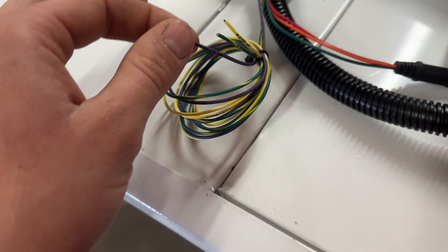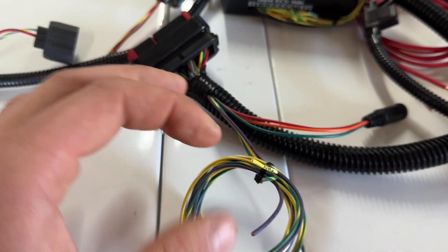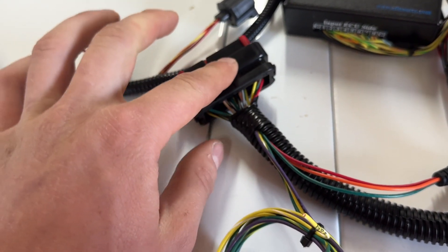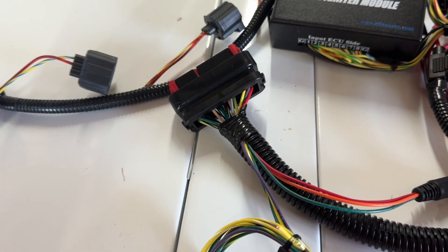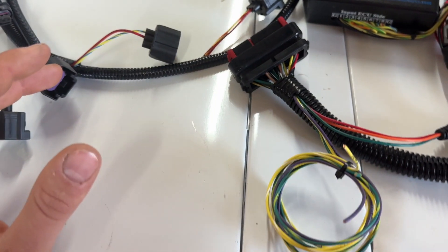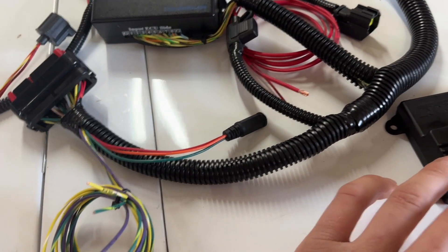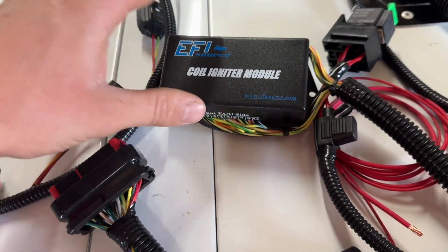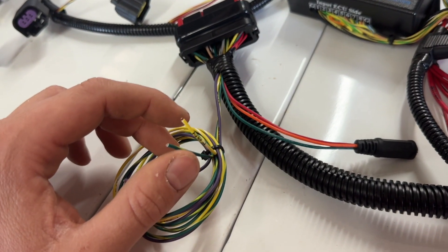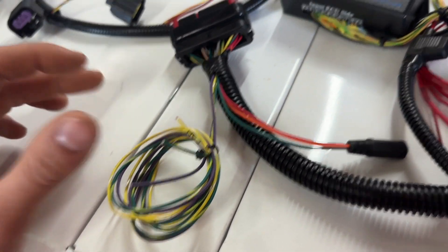Most people are probably going to need the fuel pump wire since you'd want a cheap electric fuel pump. The tach is a good one to have. I'm going to pull this connector apart, pull out that wire, and put it in pin 34, which is the wideband input on the connector. I don't really need it, and more than likely I'm not going to data log because you have to buy a separate add-on. I can just run a wideband and read it, though it's a little tricky to read while racing.